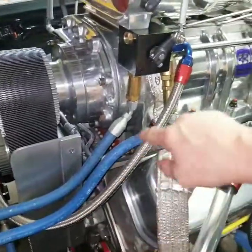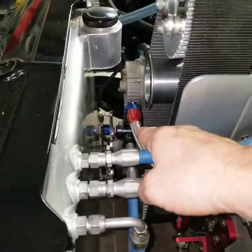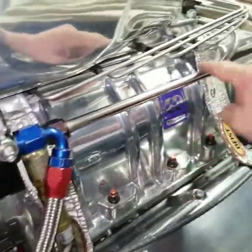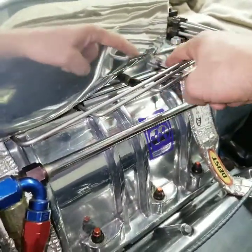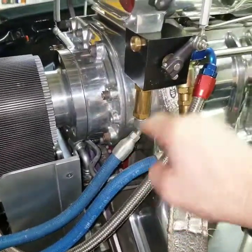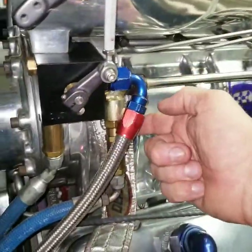This fuel here is coming from the high pressure pump down here. It comes up and meters into this line to the metering junction block, and each one of these has — you'd call it a pill — that squirts fuel in. What it doesn't use comes back here: this is the low speed bypass, and this is the high speed bypass. Pumps become more efficient at higher RPMs, but the engine actually becomes less efficient, so you go dead rich on the top end — that's why you meter out the fuel. That's also why a mechanically injected car idles roughly: as the engine speeds up it goes dead rich and slows down, then the pump cavitates, it goes lean, the engine speeds up again, and it cycles.